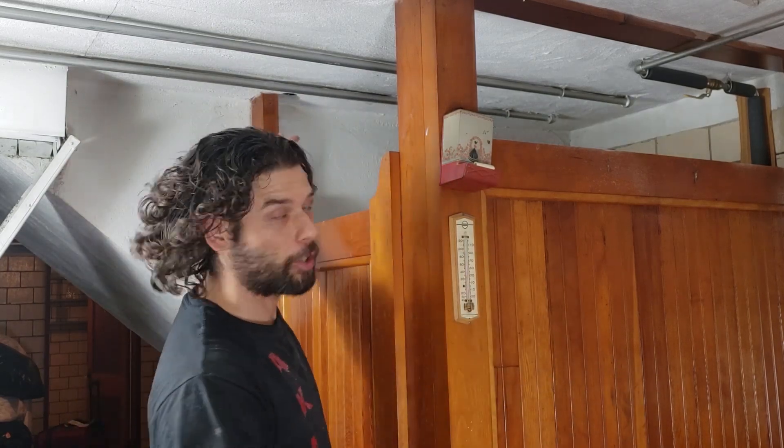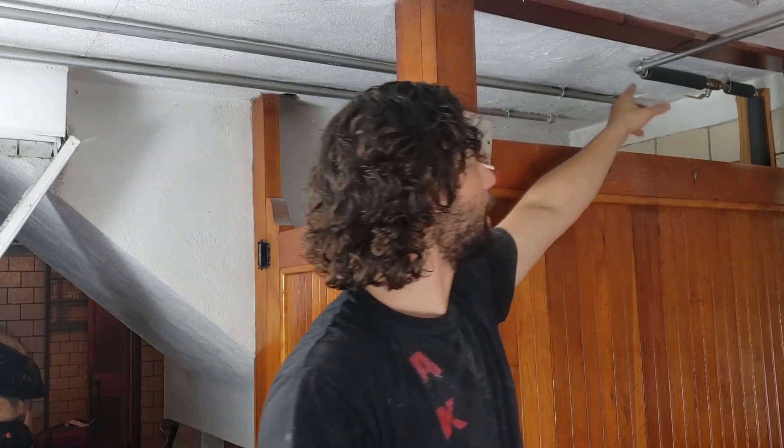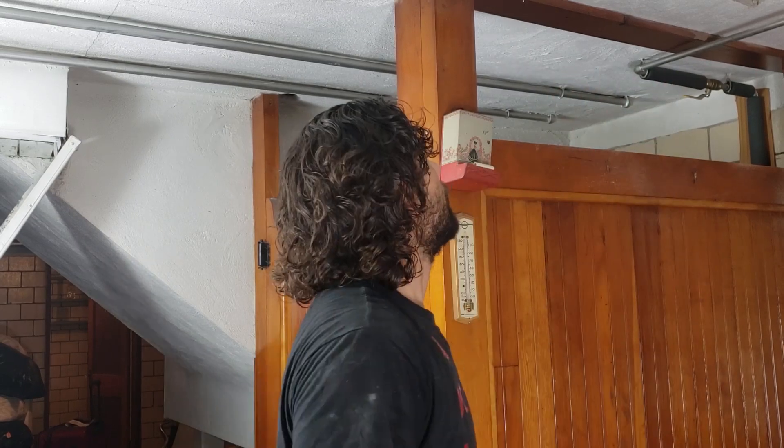PVC does not like fire, so I don't have to torch or solder anywhere near the pipe. I'm going to have the copper pipe coming out first and then connect to this part. Hopefully I don't burn that wood because it's really cool. It's going to take about five elbows or so — that's quite a bit of soldering. I did find my plumbing buckets though, so I can return the $15 worth of soldering and flux — but I should probably keep it because I know I'll use it again.